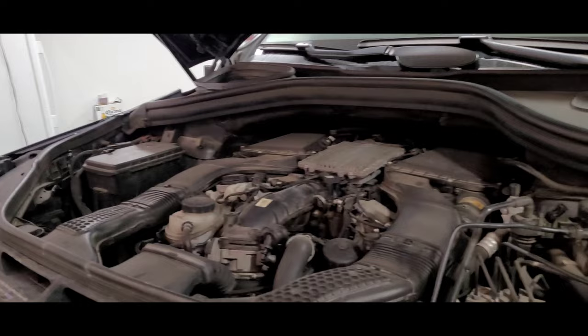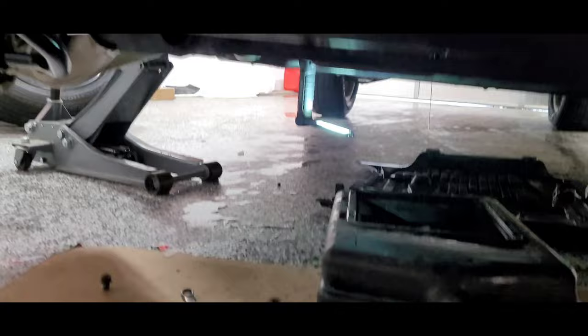What's up guys, welcome back to the channel. I'm a little dirty right now — I was just underneath the car, probably even got some oil in my hair. Anyways, I'm doing the oil change on a GLS 450 Mercedes. It's really simple to get an oil change on these cars. If it's nice and dry outside, you can just hit the raise button, raise your car up a couple inches, slide underneath, take the shield off underneath the engine, and access the drain bolt on the oil pan.